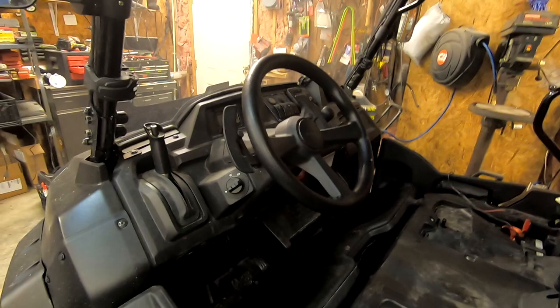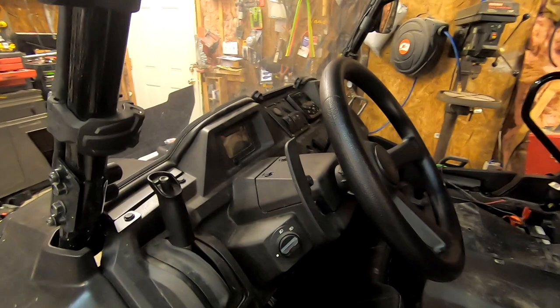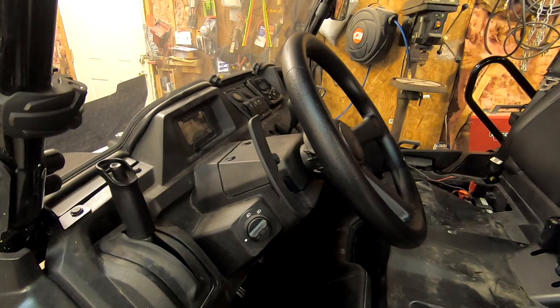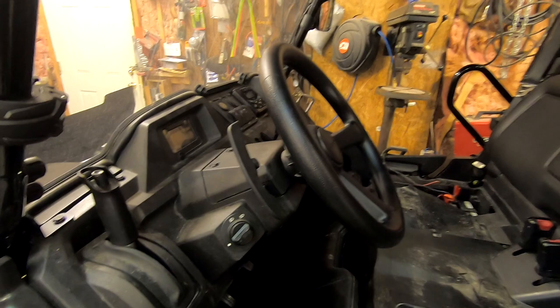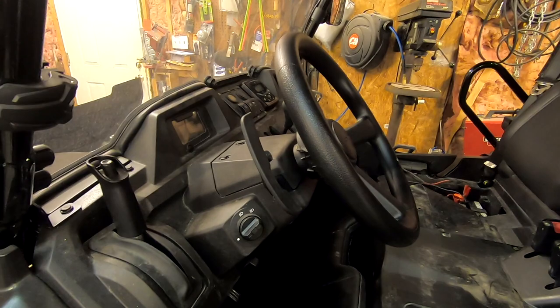But I don't think it's the magical cure. I think that these things are just a little cold-blooded by nature, and they just take a little bit to get them started, but once they're started they run good. So definitely can't hurt. That's an upgrade I do in all my power sports and motorcycle projects, is make sure it has an Iridium plug. They just do fire off a lot better, especially under harsh conditions, if you have like a rich or lean type setup.